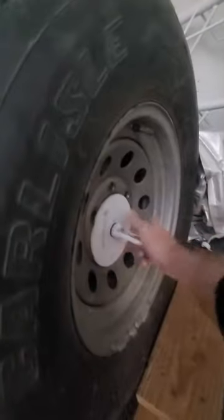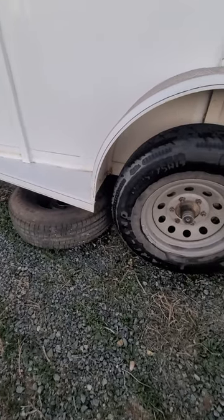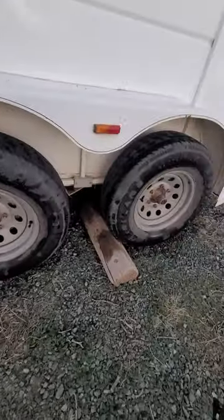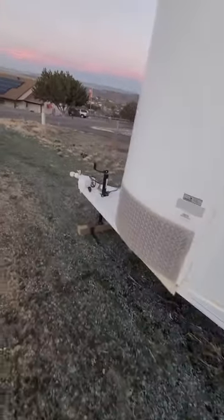We're going to center it up. Check out that tire real quick — you see that? Got the spare out now. A trick I would always tell everybody: put the spare underneath there if you're going to go under or do any side work. Also chock your tires so they don't move, and make sure your front sides are down before you jack it up — just a couple of tips.